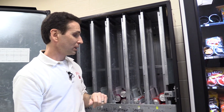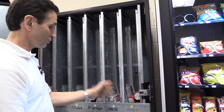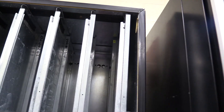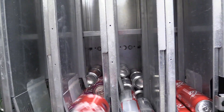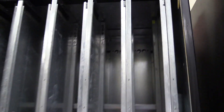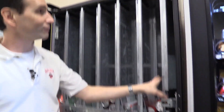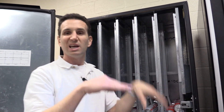The way I like to do it is to put my three most popular items in the first three selections, and they go front-back. My Coke is column one and column seven — the same product straight through. Column two is my Diet Coke, the second most popular product, and that goes column two, column eight, straight back. The third most popular product is Cherry Coke — that's column three and column nine. These three products are just straight back with no products hidden behind them, and they vend equally when you set Space to Sales this way.